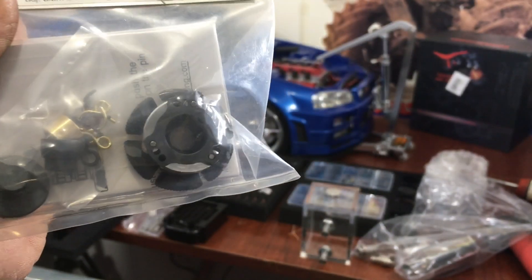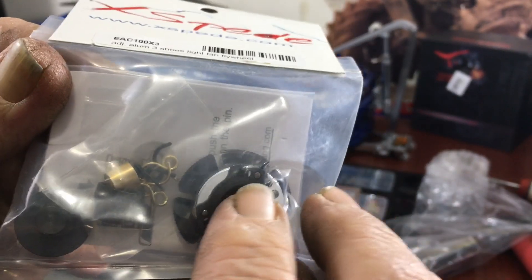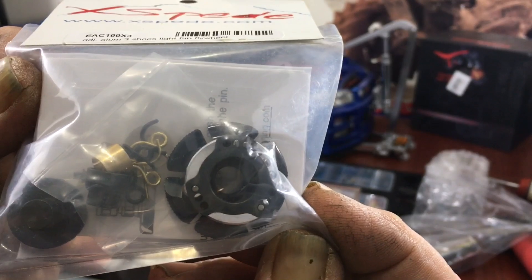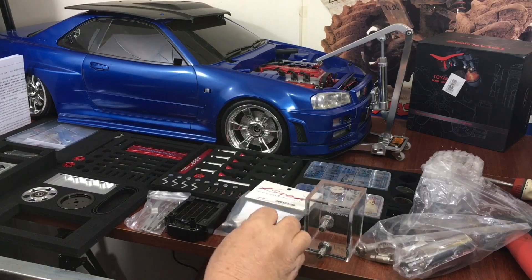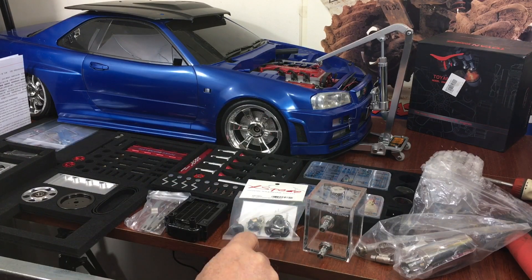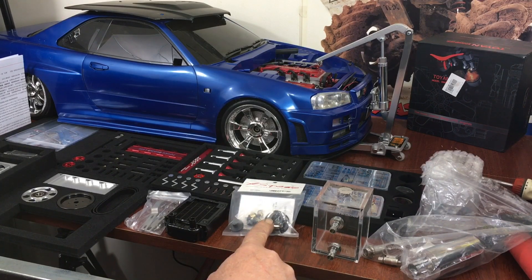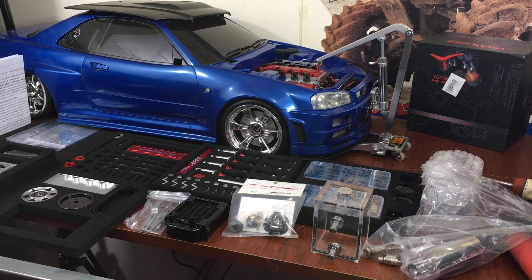These little ones — as you can see here — I'm experimenting with an adjustable clutch. They make one you can adjust with a set screw, but this one has three different spots to adjust whether you want it to launch early, mid-range, or late. I figured I'd start in the middle. The problem is you have to remove or move the engine or gearbox to change the position. The other one out there is like 100 bucks and has a set screw that moves a plate, which is pretty cool.